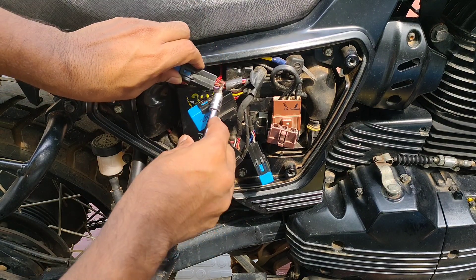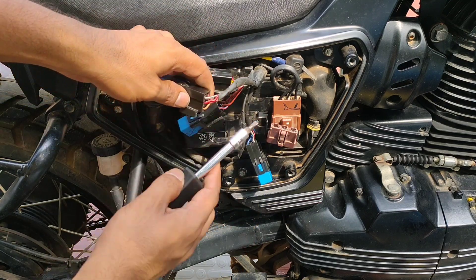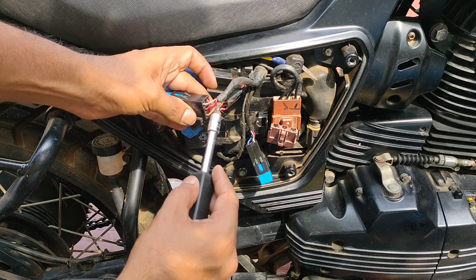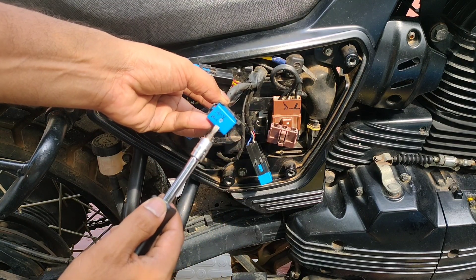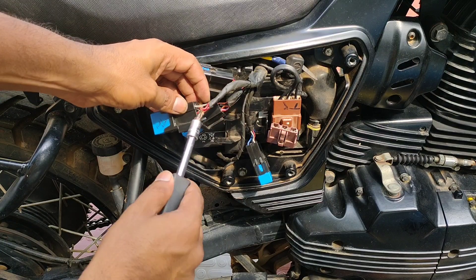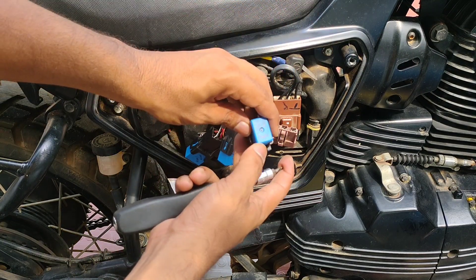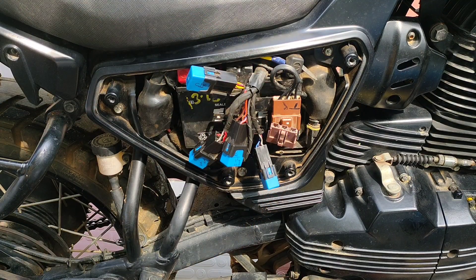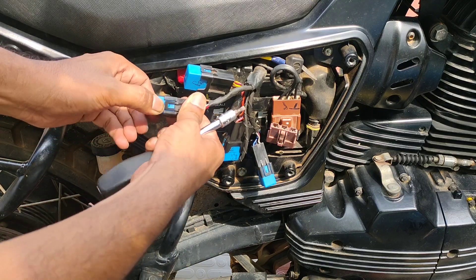Here you can see red wires completely, and the yellow wire is identifiable — that is for coolant. The white wire with the black line and red-orange wires are for the accessory port and accessories, called USB port. And blue wires, which are very identifiable here, are for starter or fuel injection. So these are the four relays which are identical.